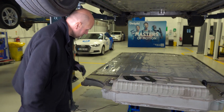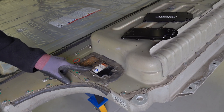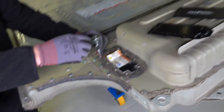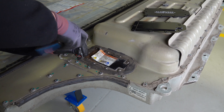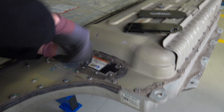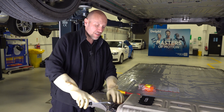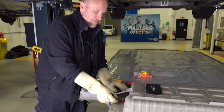Let's get the cover off. As you can see it's quite heavily corroded but not gone through thankfully. We're going to start by removing the torx bits and then breaking the seal. We've removed all the bolts on the cover wearing PPE because we are at a potential risk point. We've cleared the silicone around the outside and we're ready to lift the cover.